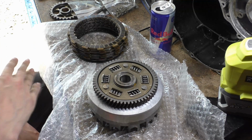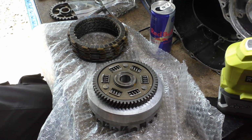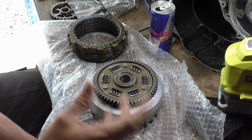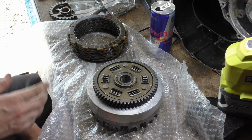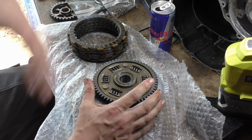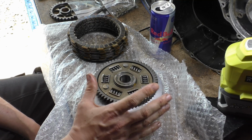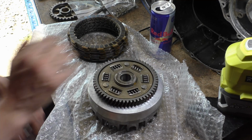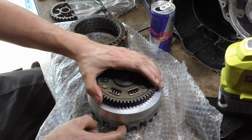So when the RPM of the engine is alternating, because we cannot hold perfect RPM, it might say 3000 RPM, but that's an approximation, it's around there. The engine is fluttering up and down, air density changes, thermal expansion rates, all sorts of reasons, and the metering of fuel is never perfect, combustion is never perfect, mixing is never perfect, and you are constantly loading the engine. It's a dynamic system, not a constant rate system. Because that happens, this clutch starts to do this. Now with this clutch it's fine, you can see the whole thing moving in unison. With the SV it's not, it's rocking backwards and forwards.